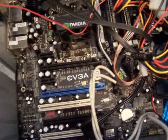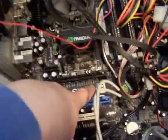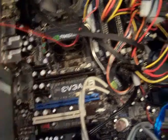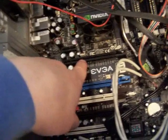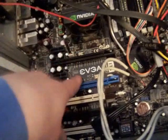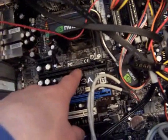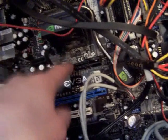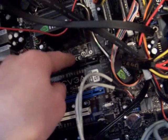To install a graphics card, you need to look for a certain slot. There are different graphics card slots, so look around your motherboard. There should be slots with labels nearby — PCI, AGP, or PCI Express. For instance, right here it says PCIe, which means PCI Express. If it says just PCI, it's a PCI slot; AGP means an AGP slot. That's the first thing you need to identify.